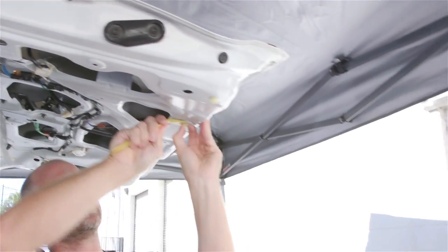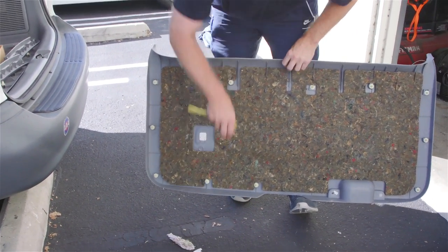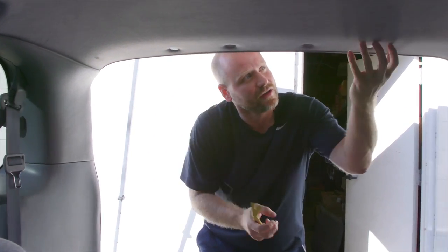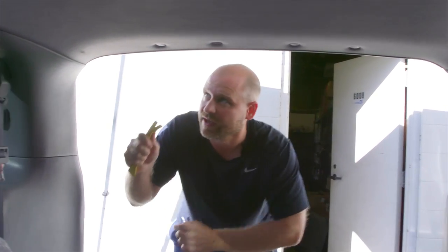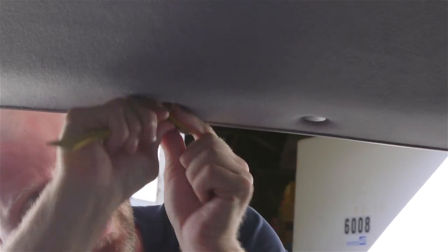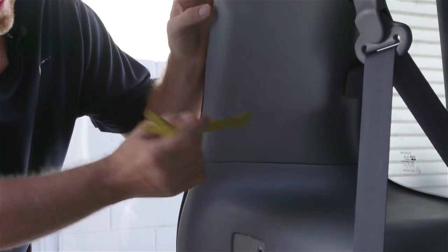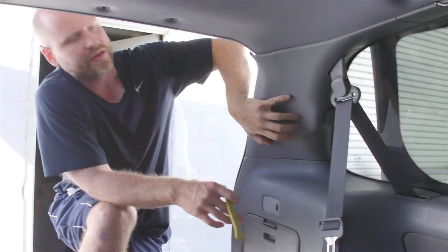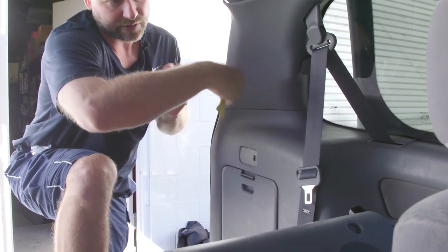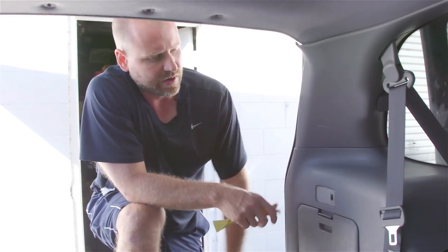Last step is to remove the panel pops that didn't come out with the panel. The next step is to gain access to the underside of the grommet. We have to take off all the finishing pieces for the headliner, so go ahead and start popping those out. You want to be a little careful not to make the headliner dirty. After popping off this side panel, we realized the large panel is actually holding this panel in. Some vehicle manufacturers do things differently — sometimes you can get away with just popping off the side panel and gently pulling out the top to run the wire behind, but in this particular vehicle we need to take everything out.